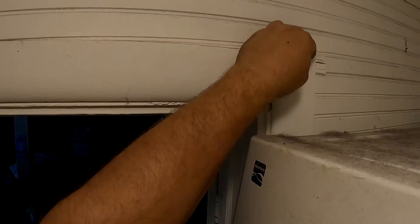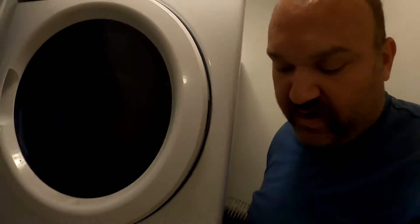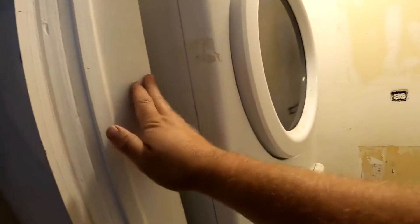But while I was working on that today, I noticed up here we have dryer lint. And when you see this in your bathroom and not in your lint trap, you know you have a venting problem. This is our dryer on top, and this is our dryer vent which goes from the dryer to outside. As we look, you can see there's a lot of lint back here. This right here is our vent, and as you can see, it's been blown off. I've had this problem with this dryer before — nothing has worked to hold it on. Our clearance is so tight with the doorframe that I have to scoot the dryer so far back I can barely get a hand back there to make the connection, and I think that's definitely contributing.